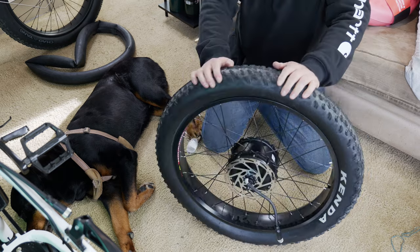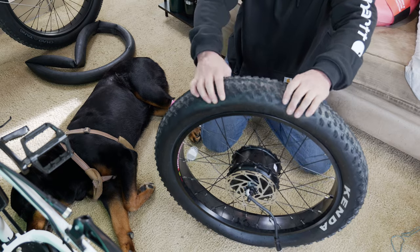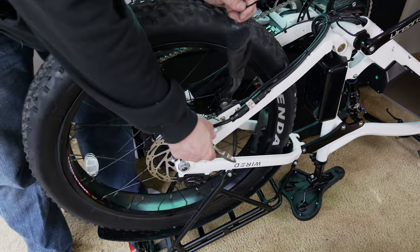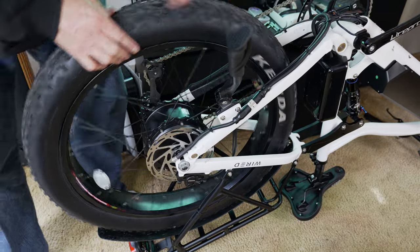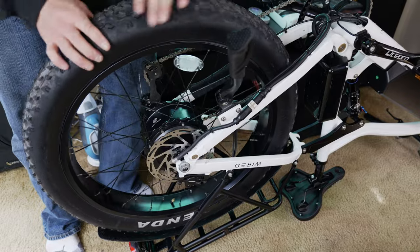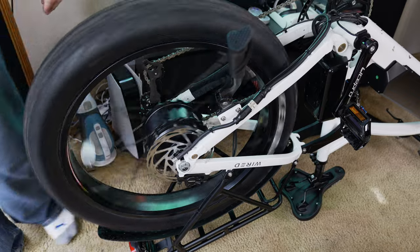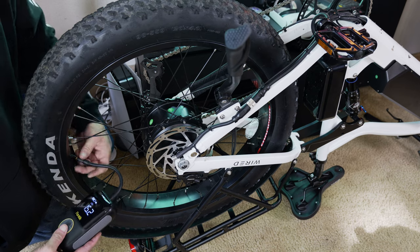There we have it — the tire insert is installed in the rear wheel. I'm going to put this back on the bike and then inflate it. You need to have zip ties in your pack because anytime you service the rear axle you'll have to cut and reattach them. Now that you have the tire on the wheel, go around and push in any lumpy spots to make sure everything's even, then go ahead and inflate the tire. We got 15 PSI.